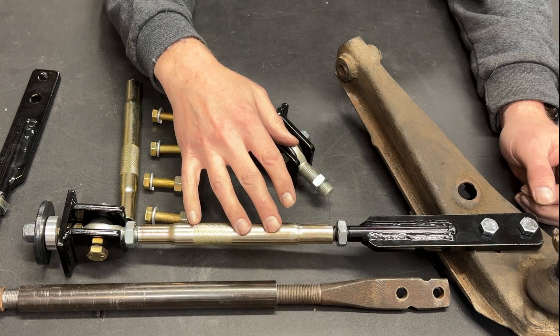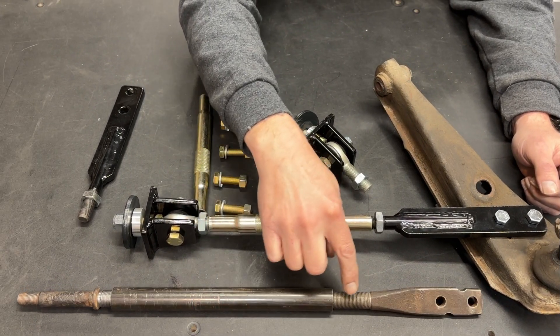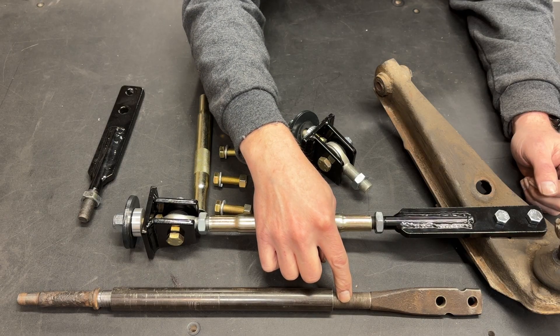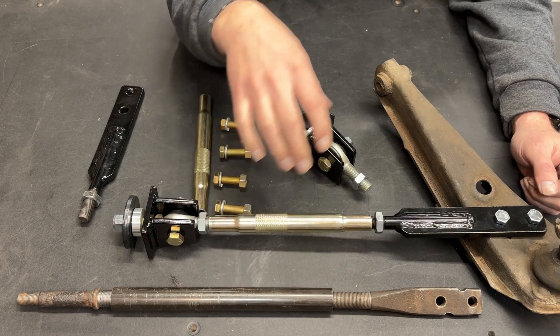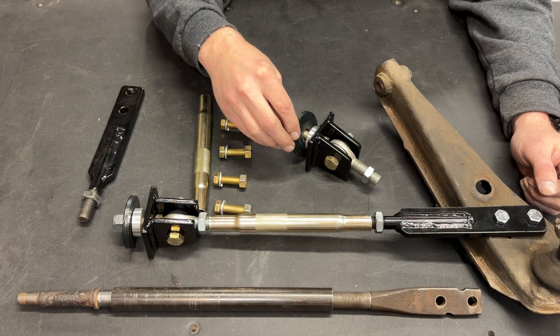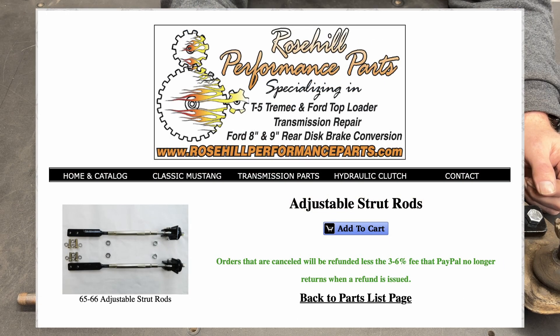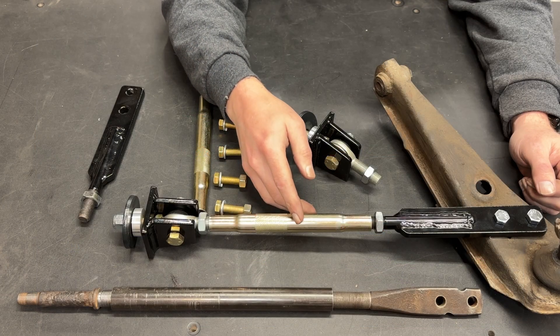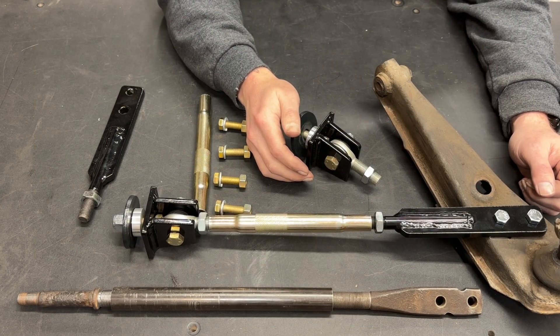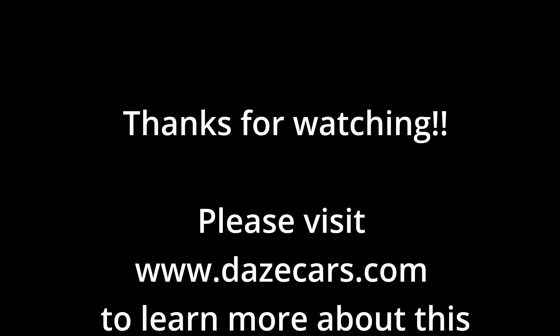If you're not interested in buying ready-made parts and you're more of a DIYer, something like this can be done — you can take an original stock strut rod, cut it, thread it, and fabricate your own head unit. There's a lot of work involved, so you'll have to weigh your time and effort against the money you want to spend. I actually have a webpage showing how to make adjustable strut rods. But if you'd rather buy a quality set, these are top-notch, very well-priced, and high quality. Put any questions in the comments and I'll get back to you — if you liked this, please click like and subscribe.